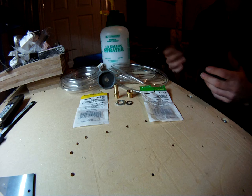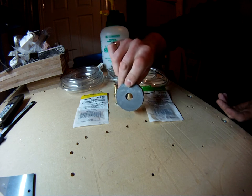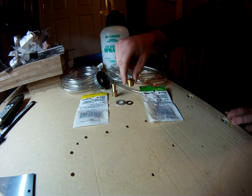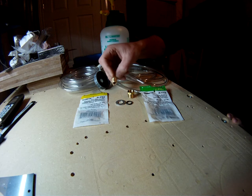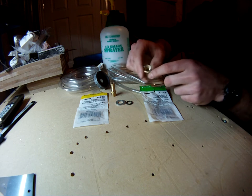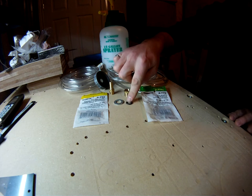A couple of things you're going to need. First, you're going to need a spare cap for whatever your master cylinder is — whether you're bleeding your brakes or your clutch, you need a spare cap. You're also going to need two brass fittings. One needs a barbed end with a male thread end, and the other needs a female threaded end so the two will mate. You'll also need a flat washer and a regular O-ring.